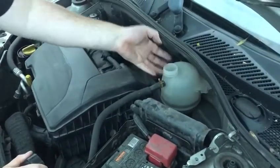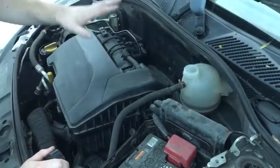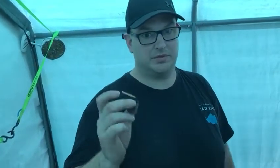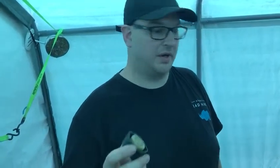The coolant will lift up through the expansion tank overflow, getting rid of all the coolant in the system. You'll just have steam inside your engine, then the engine will overheat and you'll have big problems — it can cause gasket failure and a whole array of bad issues.